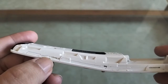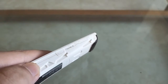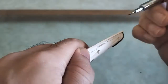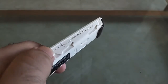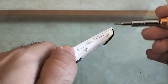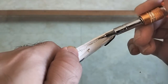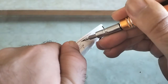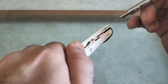Now, if you observe, there are no screws whatsoever on this remote, and what you're going to see here is there is a slight groove right here. I'm going to take a tiny screwdriver and press on it. You can take any similar equipment you might have from a mobile phone repair toolkit or any similar tool, but make sure you don't use something very sharp and be gentle and delicate in this process. You don't want to press too hard and damage the remote. So I'm going to take this as my starting point and just slightly insert the screwdriver in between.